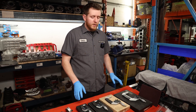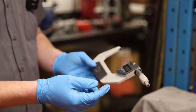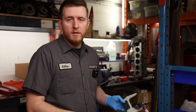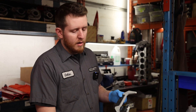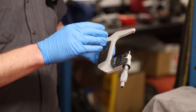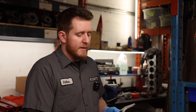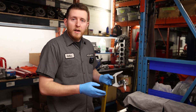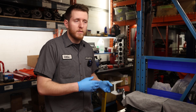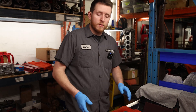One of our first primary tools we're going to be using when assembling this engine: we have four different sizes of Mitutoyo digital micrometers. These micrometers go down to a hundred thousandths of an inch, which is five decimal places past the decimal point. Our margin of error for when we assemble engines is two ten-thousandths of an inch. Anything more than that we assess whether the application will live in that margin of error or not. Generally our allowable limit is two ten-thousandths of an inch, and that sets us up for good success with any engine build.